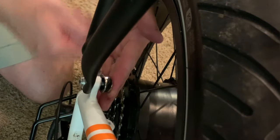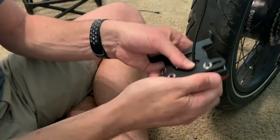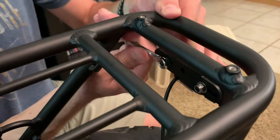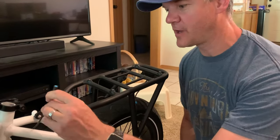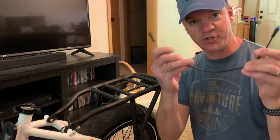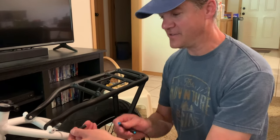The rack is now on. The last step will be to run the cable with the cable extension and remount the light on the back of the rack. I have to take this taillight off of the original bracket and then the taillight will go right here. We're tightening this using an eight millimeter wrench — unfortunately I don't have a ratchet one, so I just have to do it the old fashioned way. Next we have to connect the power cable from the taillight all the way up to the small cable coming out of the control unit. We have this little stub here and this little stub here, and the rack kit should have included a light extension cable. We just hook them together and then use the zip ties to tie it all down.